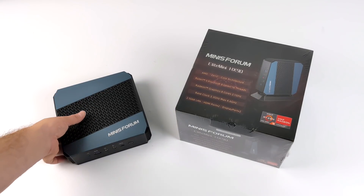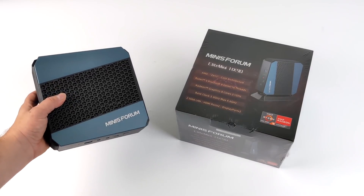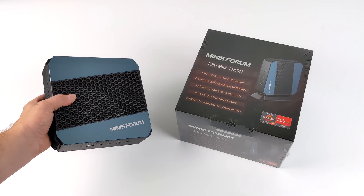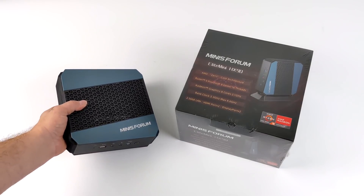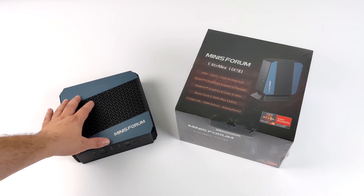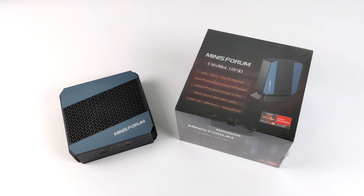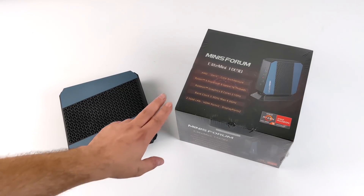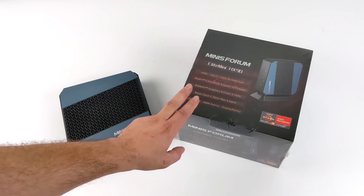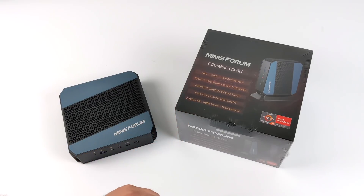Over on the product page, you'll see that it states this thing uses liquid metal to help keep that CPU cool. Instead of using regular old thermal compound, the HX90 should have liquid metal on it. Unfortunately, this actually turned out to be a big mess for some reviewers. They sent Gamers Nexus two of these units, and there was liquid metal all over the interior. Come to find out, as soon as he pulled that heatsink off, it wasn't using liquid metal at all. It looks like they initially applied it, it really didn't work out, so they just went with regular thermal paste. This does present a problem because this liquid metal is super conductive — if it gets in between any connectors or circuits on the board, they can definitely short it out, and there is a chance it could even cause a fire.